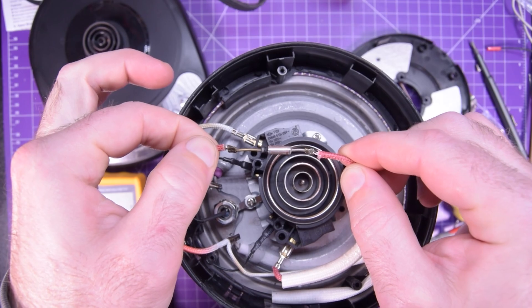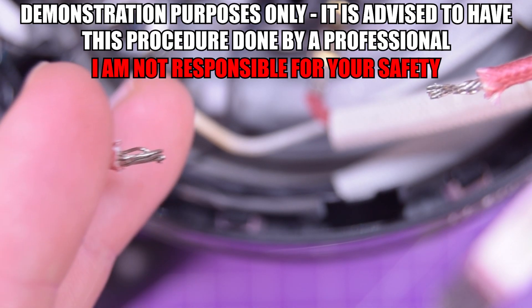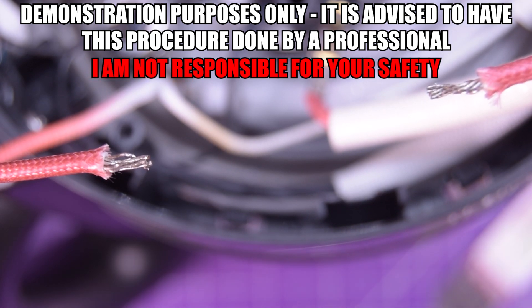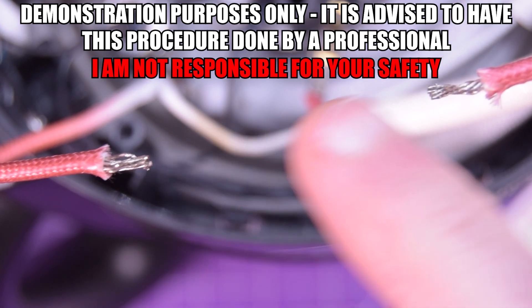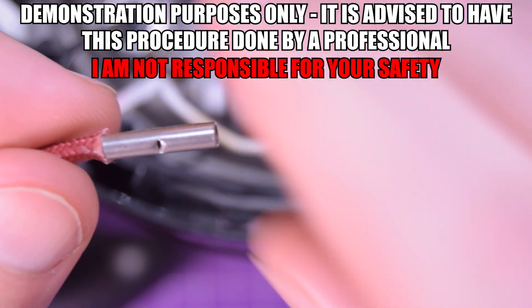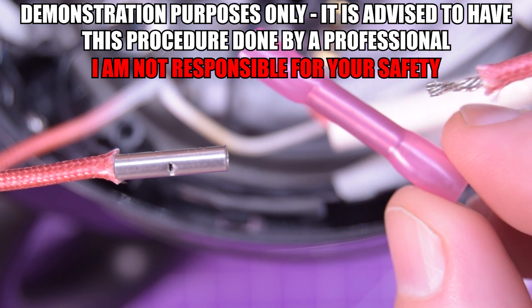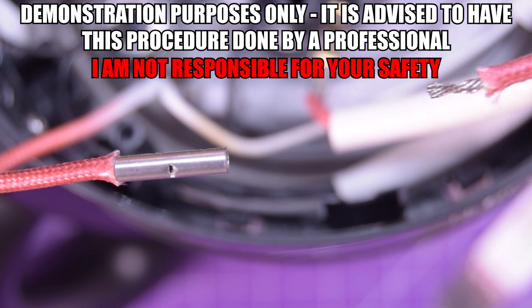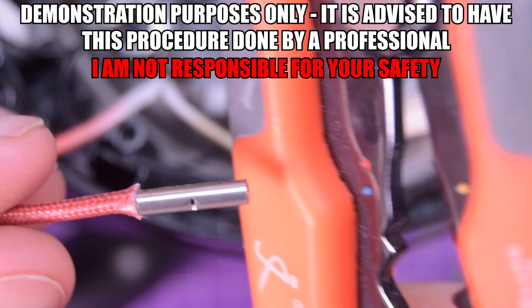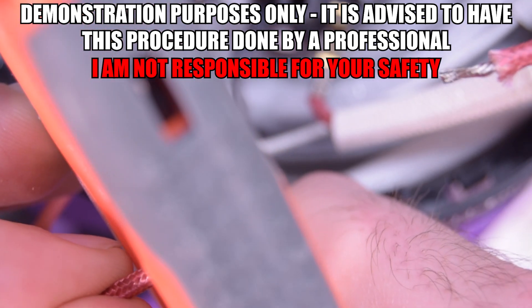And there is the thermal fuse that I had already replaced. You can just cut these wires off here with some snippers, strip a little bit back, and then put new crimps on. I prefer to cut the old crimps off to get the same length of wire set up and then just put new crimps on the end. You can either buy these crimps separately — link in the description — or I just took the insulation off one of these insulated ones. You don't want to leave the insulation on because that might be flammable.